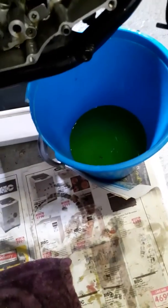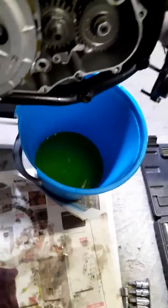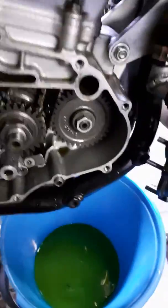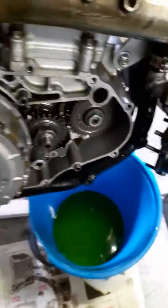Looks easy enough. Next we're going to put in the pressure plate - or as I call it, the boss. Then the clutch springs. Some of you might want to laugh at my terminology - knock yourself out. Clutch slip is also caused by wrong tightening - if you tighten these bolts unevenly, you're going to have problems with your clutch plates and stainless steel plates not separating properly. Very important to tighten these in a sequence, evenly.